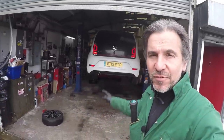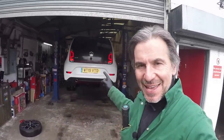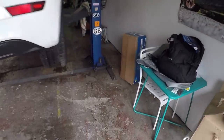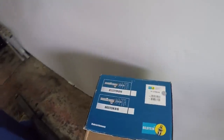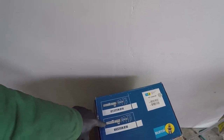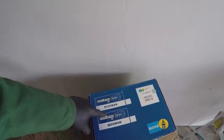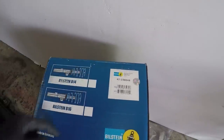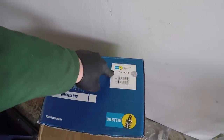We've got the Bilstein UP GTI in the air. Before we have a look at what's been fitted to it, let's have a look at the box it all came in. The box says B14 and B16, but I'm pretty sure we've got the B14, the cheaper version, because we haven't got an adjuster at the bottom of the strut. The part number fitted to this car is shown on screen — if you want to order the same, that's what you need. These were ordered in the summer of 2019, so should still be current.